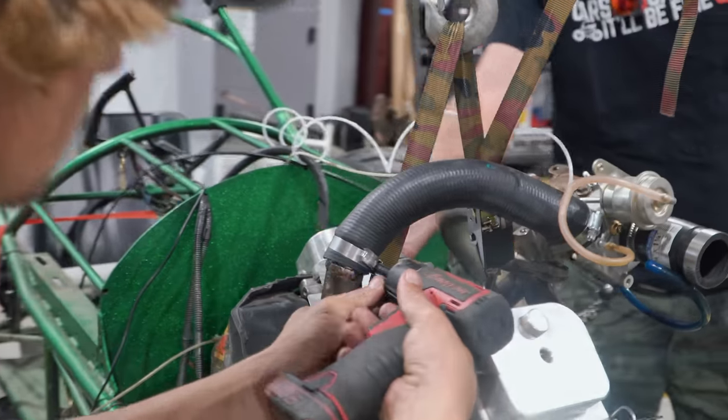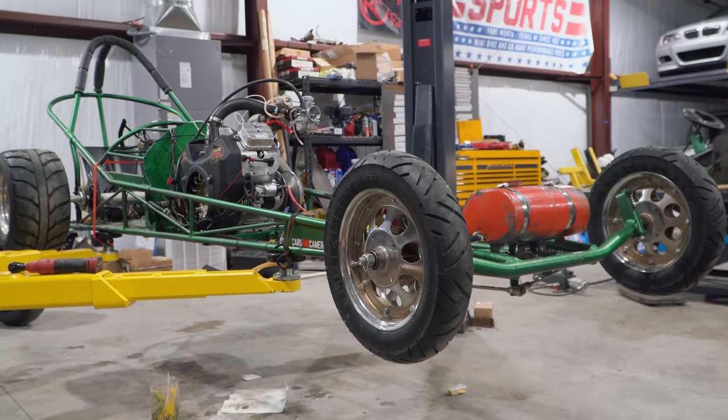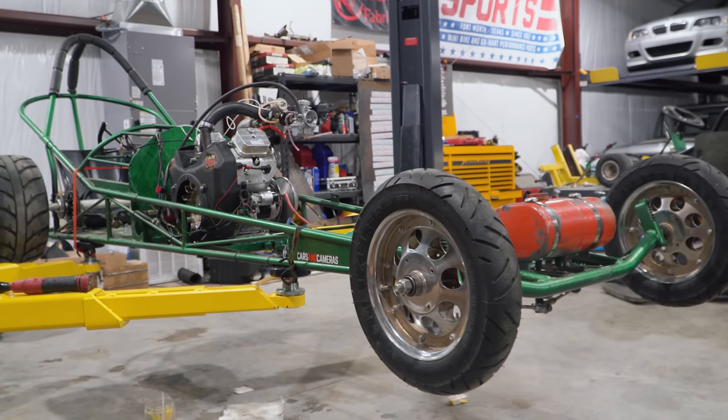Don't want to lose a charge pipe. The 670 is looking great. We're going to go ahead and end the episode now — I know it looks like it's ready to fire up but we have some other things to finish before we can run it on methanol. I need to do a bit more calculating with my jetting to make sure we don't blow this thing up running too lean. We need to get our air-fuel ratio gauge installed and plumbed up before we fire it up to make sure we have a good baseline tune. But we are getting darn close and it's going to be epic. Thank you all for watching — visit cars-cameras.com and pick up some merchandise to support the channel. We have a new 'Vote for Turbo' dragster-themed t-shirt and certified gap welder patches, easy to install, perfect for your welding coat or shop shirt. Catch you next time.